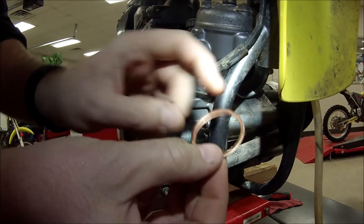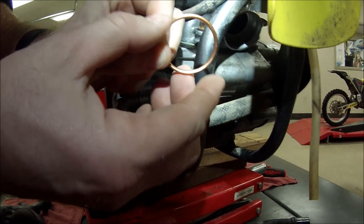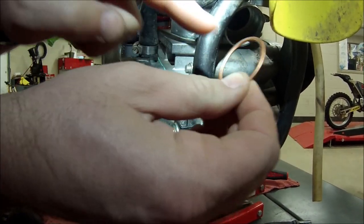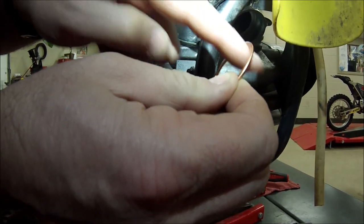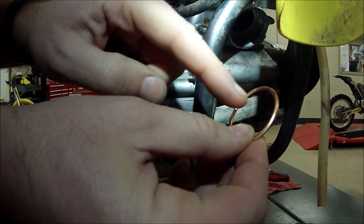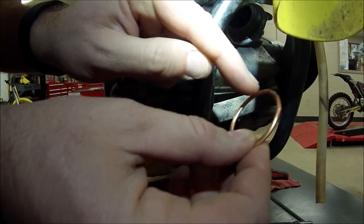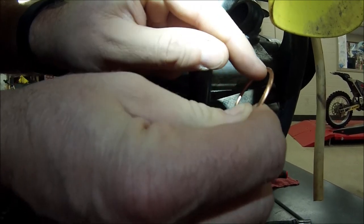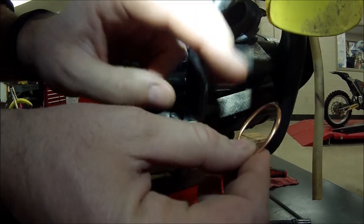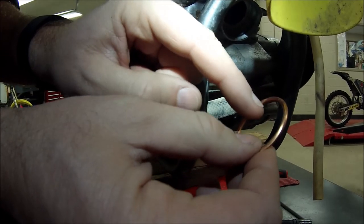My tip is: I always put the flat side facing in. The copper side here is going to compress, and the reason for that is as the exhaust is escaping out of the engine it's going to go right on by and out the pipe. If you do it the other way — and you guys have seen this when you've taken an engine apart where the exhaust gasket is 'blown' — that exhaust gas will grab that seam and rip the gasket out. That's basically how a copper gasket 'blows.'